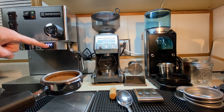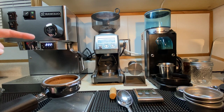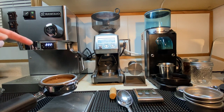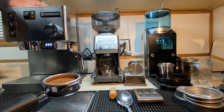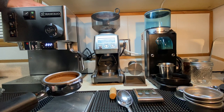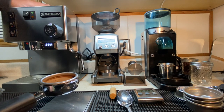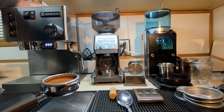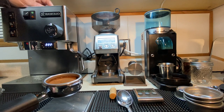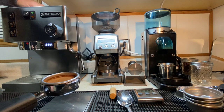We've got our puck. We know our boiler water. A question that comes up is: 222°F — is that too hot to be running water over the grounds? This is the temperature of a thermometer located on the outside of the boiler — that's not the water that's coming through. The boiler is holding all that water to a certain temp, it bumps it, and it runs through a bunch of pipes and fittings and drops from whatever that temperature is.